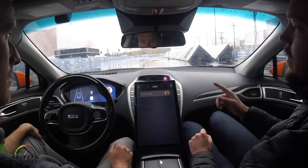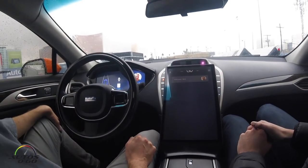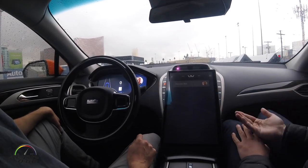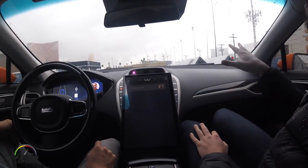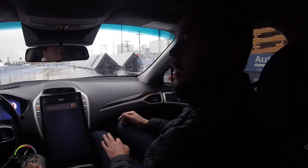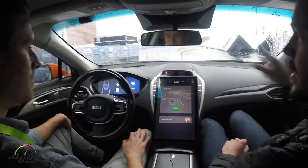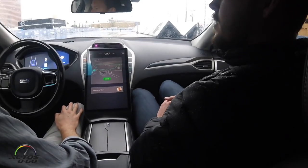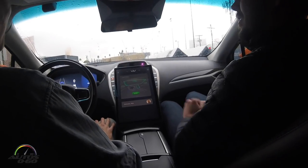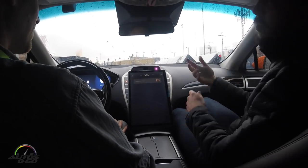Another sensor we'll show you today is our Driver Monitoring System — that's the IR camera here that tracks where you're looking. We use it to see what you're looking at in the car, whether it's the mirrors or screens. That way the system can adapt the messages it gives you. If you're looking at the screen it might warn you about something, but if you're already looking forward it won't. You can try looking around now — windshield, left mirror, rearview mirror, center display, right mirror.